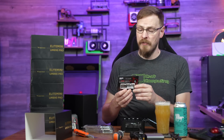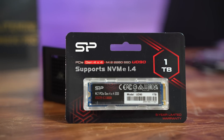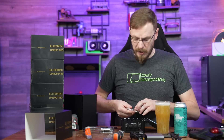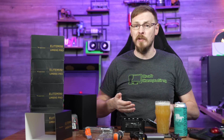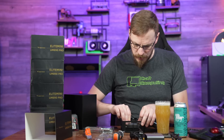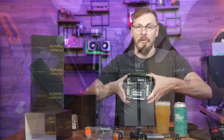As for what I'm putting into these machines: I've got a Silicon Power UD90 Gen 4x4 1TB NVMe drive with speeds upwards of about 7,000 MB/s in sequential reads and writes — more than fast enough for this application. We've also got 32GB of DDR5 5600 from Team Group. While I have worked with both companies before, none of this is sponsored. These are parts I've used before, have been very reliable for me, and I'd absolutely recommend. In goes our SSD, and we'll also install the OcuLink M.2 adapter.